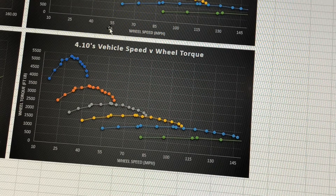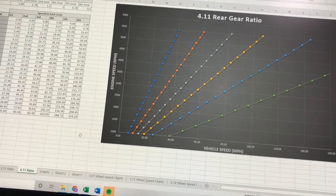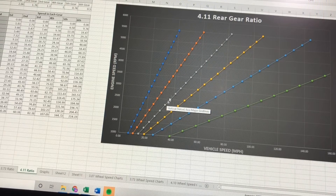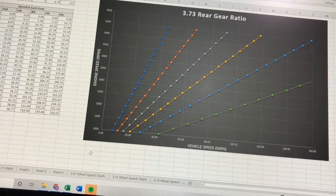I kind of hoped after doing all this analysis I'd be able to determine exactly what gear ratio I wanted. But as it turns out, I think 3.73s or 4.11s will both work — I just need to pick which one. The trade-off for 4.11s: a little worse mileage, potentially less traction in the lower gears, but it'll accelerate quicker and might be a little cooler. 3.73s might be more streetable but you give up some acceleration. Hopefully these tables will help me, and maybe they'll help you too. Please ask any questions.